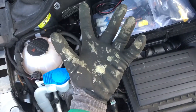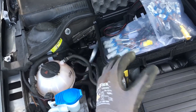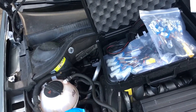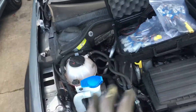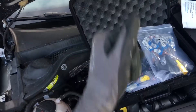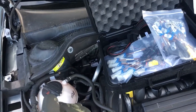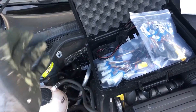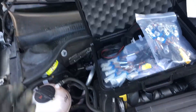What you'll see on your gauges in the morning when it's cold — we're in the 50s — is say 90 psi on the high side, and a tire shop technician not used to wintertime AC work would say the charge is low. He would perform a recover and recharge and say it was just a low AC charge — without actually measuring what came out.